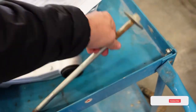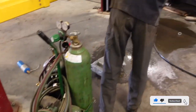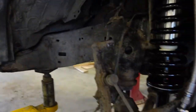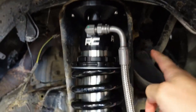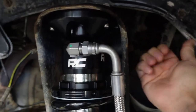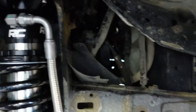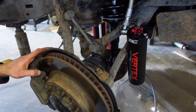All right, so where are we at? We've got the mega long upper control arm bolts out. And what we did was, hey Serge. Hey man. So the bolt went across here, right? There was the nut there, the head here. And all we did was use the pry bar and kind of move this, and then you can sneak it back. There's some wires back there you've got to watch for. We moved it back this way, and it went through. Got the new strut in there, reservoir's hanging.